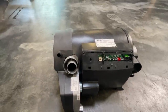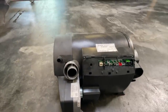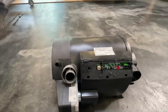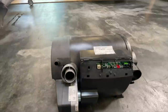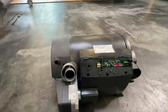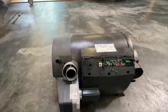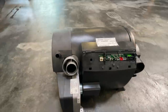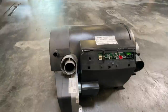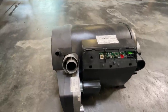When you understand how long it takes to remove something like this and put it back in again - the costs really add up. So really, people, always pay attention. I can only give you this good tip again and again: let your diesel heaters burn free. Switch them on for half an hour, three quarters of an hour, then full power to the highest setting - 30 degrees or highest level - and really let them burn properly. Especially during heating periods, this is always important so the thing burns free properly.